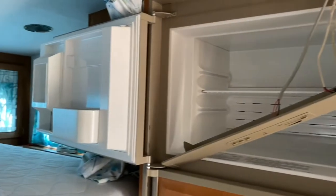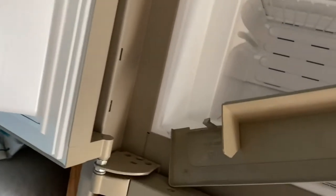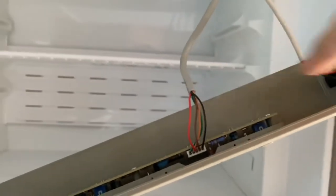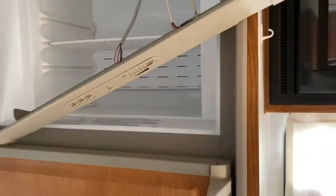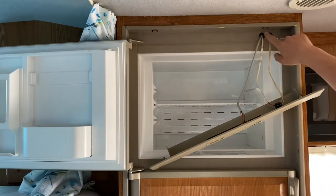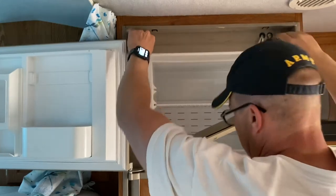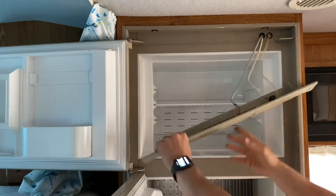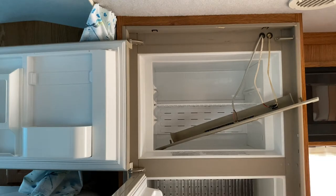On the Dometic there are little plastic clamps — clips right here — that you just press in, which is really nice. They're on both sides and it popped right down. You can disconnect your wires right now, but I would recommend always taking a picture of the way the wires are set up because by the time you get back to this it may possibly be a few months and you might forget. Then we have two screws on the bottom, which are phillips head.